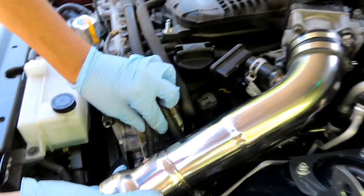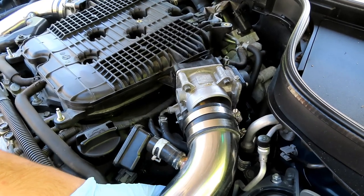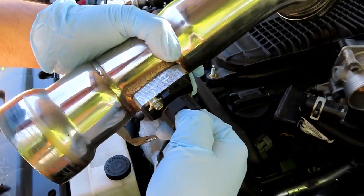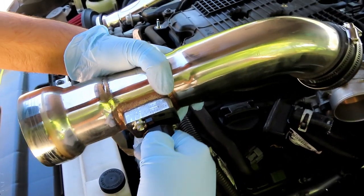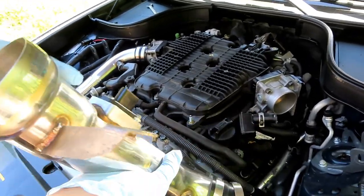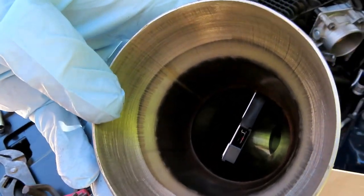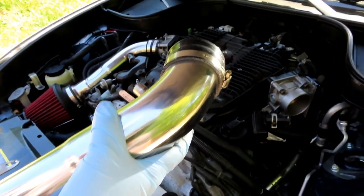That's that — I think it's pretty much out. Slip it off the throttle body, get this hose off, then just push this tab right here, push down, and wiggle it off. I already recently cleaned my MAF sensor, so if you haven't cleaned yours, I'd get some MAF sensor cleaner and spray it while you have it off.